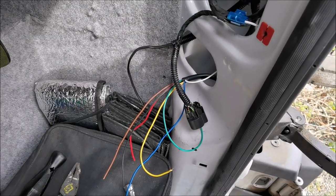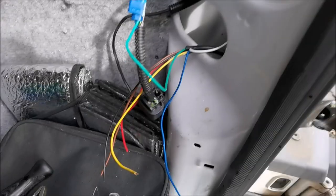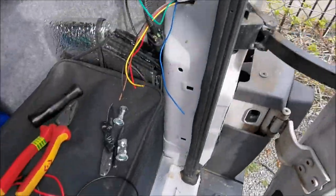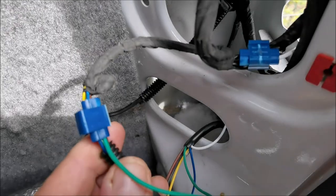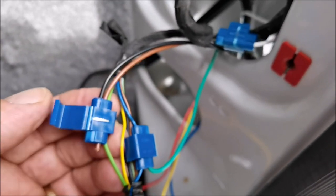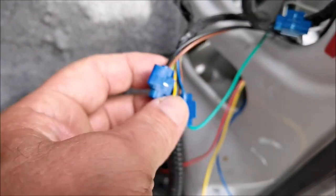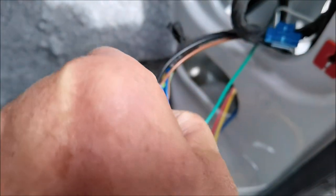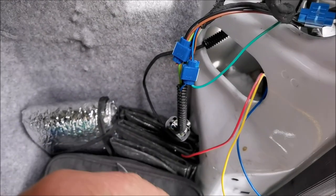I think if you put the two together it should work — we'll give it a go. So what I've done is found the green, which is the tail light and number plate — which is the brown and black — put them together, and yeah, we've got a connection and they both work. Now someone's going to say you can't do that. Well it seems to work, and I'm only running LEDs, I'm not running 12 volt bulbs, so the wattage is nothing, absolutely nothing. So if I'm wrong, please leave a comment down below. Honestly, I don't mind.